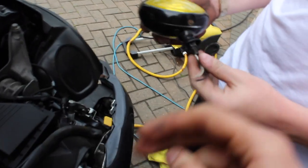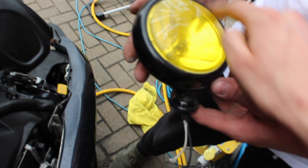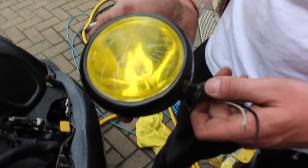What we're actually going to do — which they don't do from the factory — the reason why they corroded is because water got in and they started rusting. So we're going to pop that cap off and run a line of sealer around it, just to help stop water getting in.